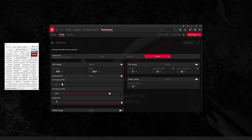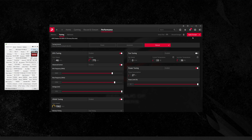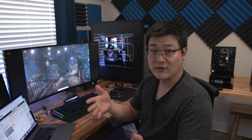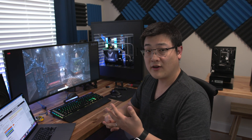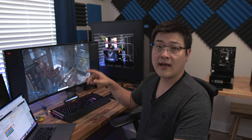When you switch to manual overclocking, that's where you get to play with all the settings. I ended up going with a 15% power draw increase, giving about 345 watts of overhead. I dialed in the core at 2600–2700 MHz minimum/maximum, memory slider all the way up to maximum — I think 2150 MHz — and voltage all the way up to maximum. In-game or in benchmarks that translates to about 2650 MHz.